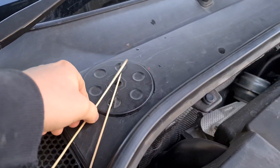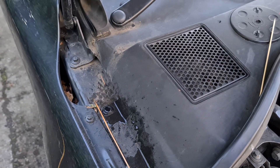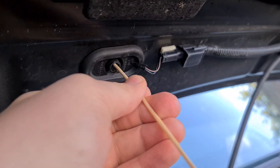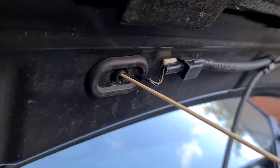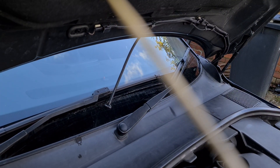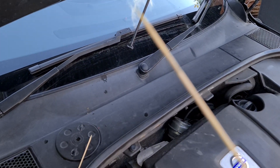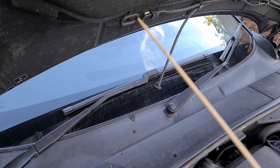The first method I'm going to use is the stick method — just take a kebab skewer and poke it up in the hole and hope that clears it a bit. I've actually tried it here before; I wonder what the Volvo mechanics must have thought finding cocktail sticks everywhere. Just slide it up in there until it won't go any more and root around as much as you can. These get blocked up from limescale or general minerals in the water you use, which is why you should use proper washer fluid. You can already see some dirt coming out.